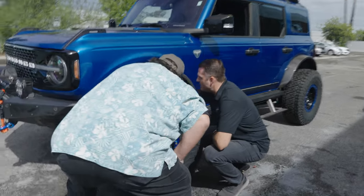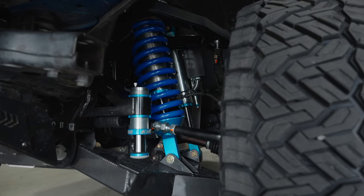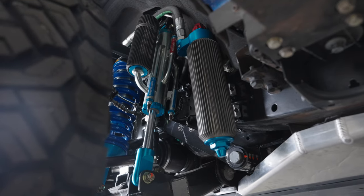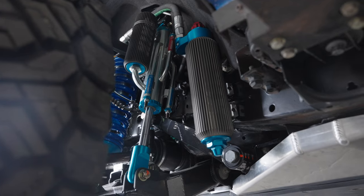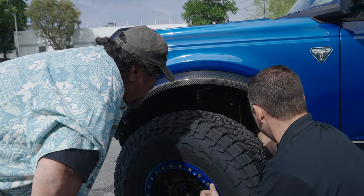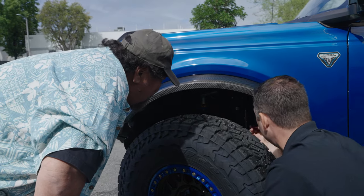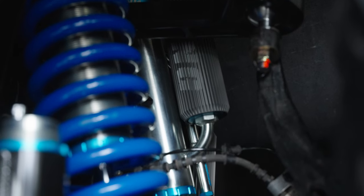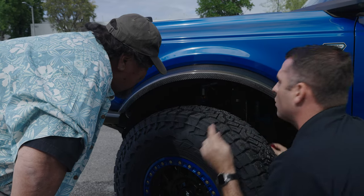So you've got your primary coilover. This has internal bypass on it already — meaning that as soon as that shock compresses beyond a certain point, it's going to change the valving and stiffen up. But then you've got your compression adjusters right here. This is a race grade reservoir — open it up, it's got a red cap that just unscrews. Now this cap is a debris cap, but it's also your tool. You turn it around, set it on top of the shock body, and as you turn and click, that's your actual adjuster. You can use a wrench or an Allen if you want, but this just makes it easier. Right now we typically set them for full loose — all the way left — as soft as this shock will allow without revalving it.